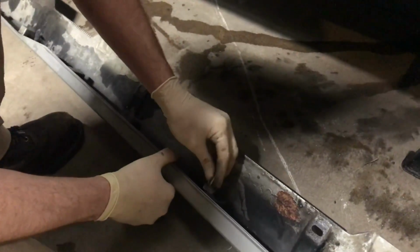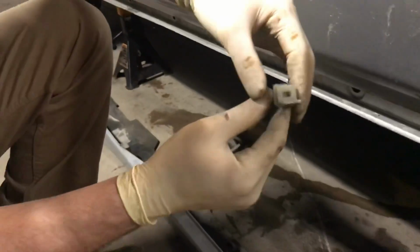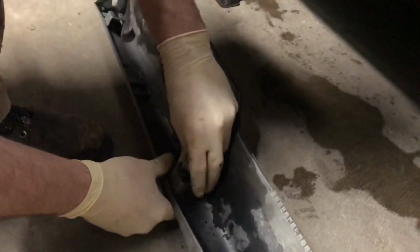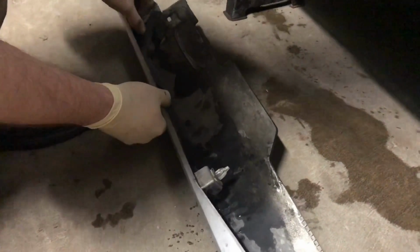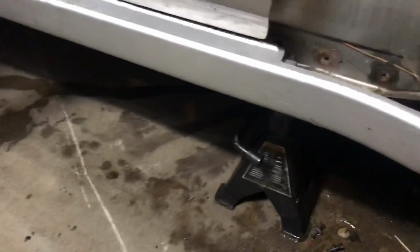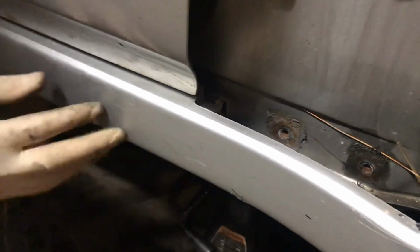This part takes a second. When you put them in, you put them in with the angled part down, like so. They just pop in most of the way. It's not an exact science, because they will move around as they adjust to their tolerance when they line up with the body. You pick the skirt up, and say you have your fenders. You can fight these a little bit, but typically you just get the clips lined up.